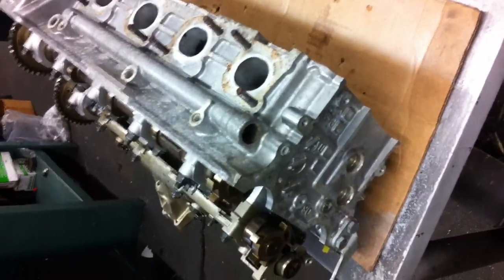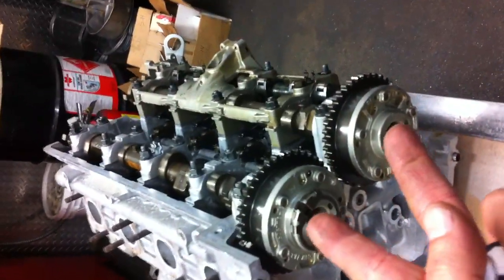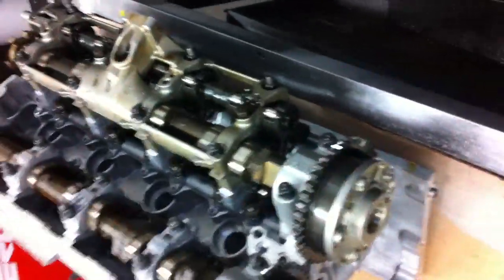This is the video for the N62 valvetronic cylinder heads. They get the air injection faults. These are the two Vanos units. The valvetronic mechanism gear is on the intake side; the exhaust side doesn't have it. The air injection ports on these engines are in the back.